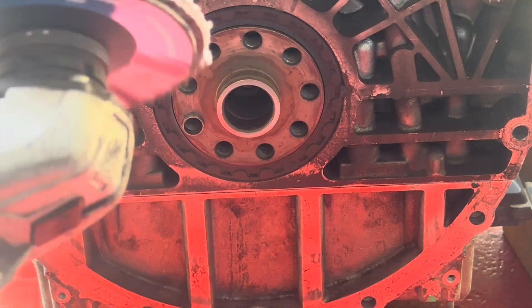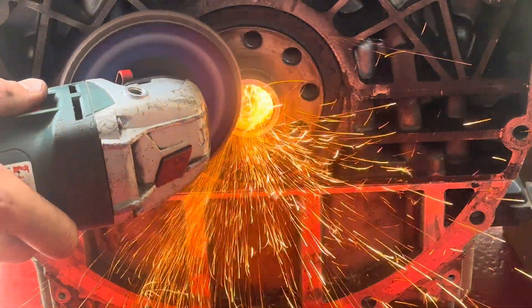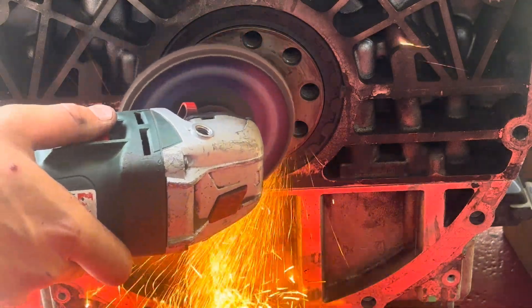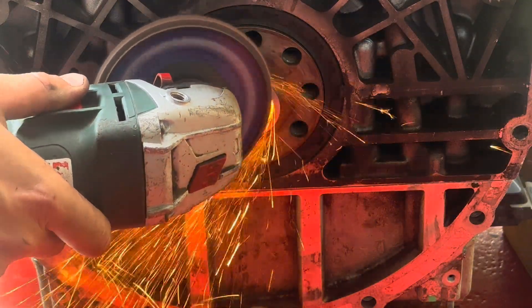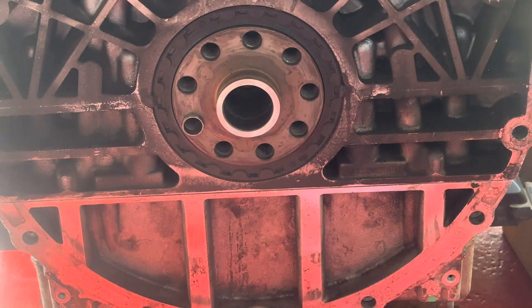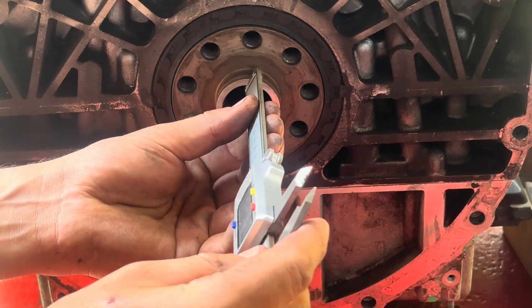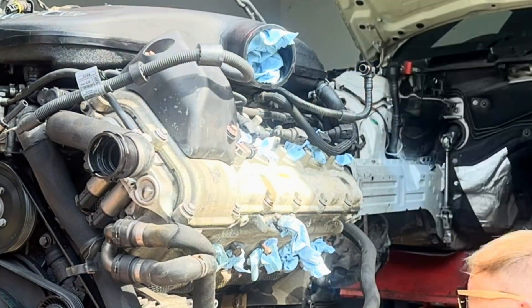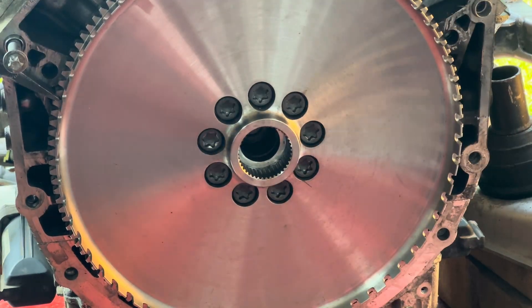The best way of doing this is taking the whole crank assembly out and giving it to a machine shop. Personally, I was a bit late to realising this was going to be a problem and had already done the rod bearings and various other things. I did some research and found various other people have done the same thing — simply filing it down yourself. If you do this, you need to make sure it is dead straight and perfectly within its tolerances either side, because where this crankshaft will be spinning at very high RPM, any imbalance will add additional strain to the rod bearings — already a weak point on this engine. Spend time with a vernier and a straight edge to get it exactly right. My official advice is to take it to a machine shop; I do not recommend doing what I'm doing — this is my personal engine and my personal risk.